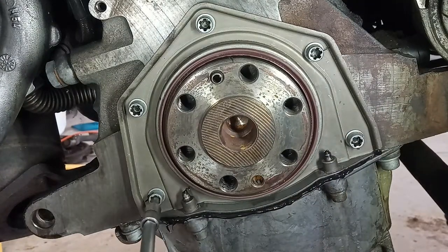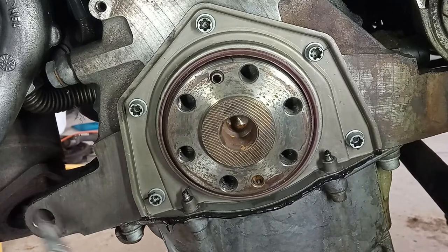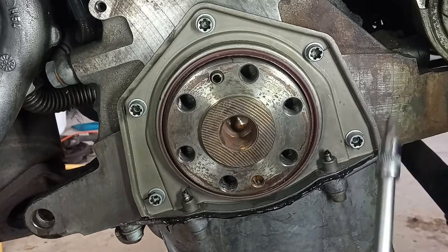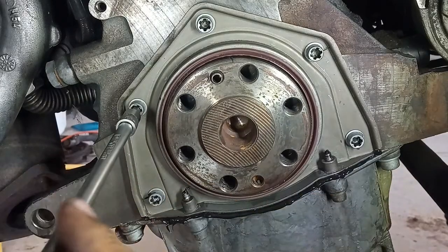As a bonus, next you need to put in the sheet metal — it goes between the engine and gearbox and is secured with two bolts. But make sure the guides are in on both sides before you do that. Then put the flywheel in and the clutch in.